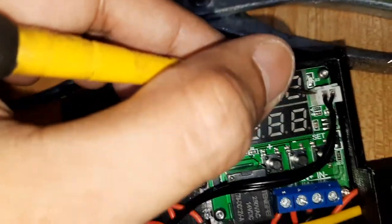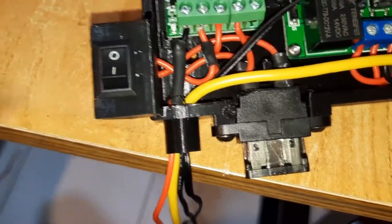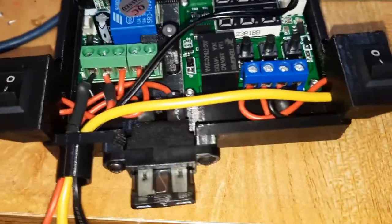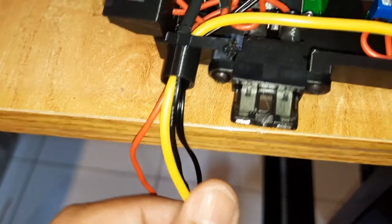So, and then we have also the sensor wires, sensor connector and the sensor wire probe for it going through this conduit, all right, and so there's four wires here. One is the positive, negative, which is coming in, supplying power to both circuits, and next we have the positive coming out from the temp control relay, which will go to the engine bay to activate the 4-pin relay, the high power 4-pin relay, right? And the last cable is the sensor temperature cable, which will go also to the engine bay and measure the temperature over the turbo, right?